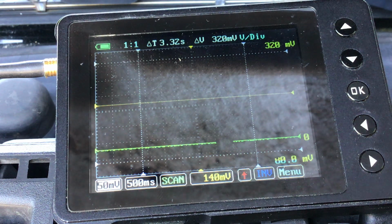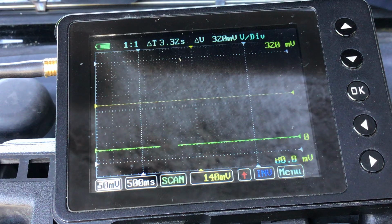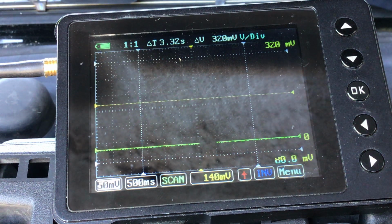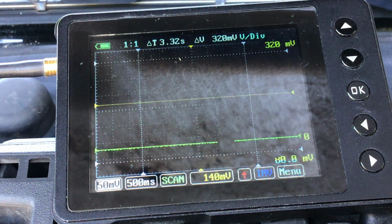I'm going to slowly roll the crank clockwise. I've got a wrench on the harmonic balancer. The Honda has real good accessibility with that little trap door on the right side, lower by the right front tire. Anyway, I will turn that. You will see it slow. I'm going to turn it real slow, and I'm looking for a slow pressure rise. And then I will hit the plateau, and then I know that piston's at top dead center on the compression stroke. And I look at the harmonic balancer to verify that. So here we go. I'm going to make a slow clockwise roll with the crank.